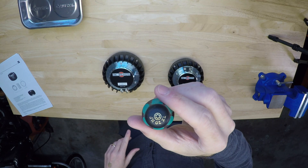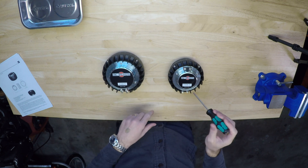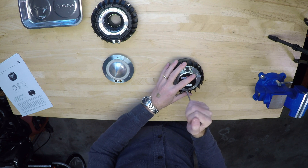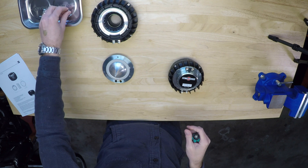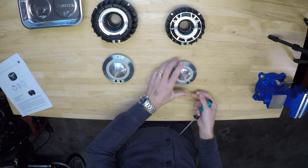The first thing you're going to want to get if you want to take one of these drivers apart is a T20 driver. All these Torx screws are Torx 20, and both drivers come apart pretty much the same. You can remove the high-frequency motor. This will void your warranty. This 354 I'm taking apart is actually the first one to enter the country. I have one on my desk from NAMM and I opened it up hoping to do this video, but there was nothing inside of it, so I had to get another one.